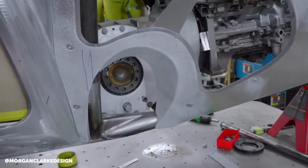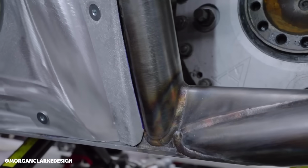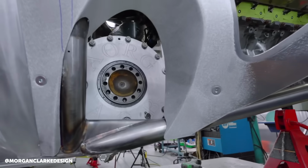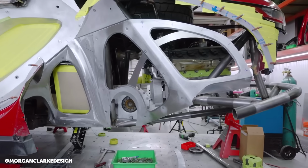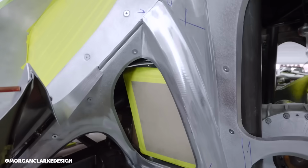No, I think a lot of people who haven't lived day to day with a sequential dog engagement gearbox don't understand that they do get pretty tiring, particularly in stop-start traffic. So Synchromesh, basically an OE style shift, nice and easy, but you obviously have to use the clutch.